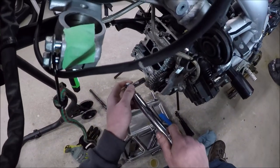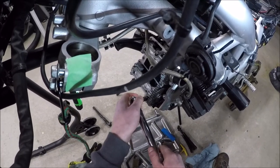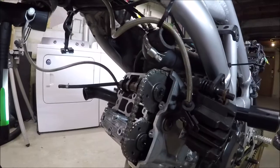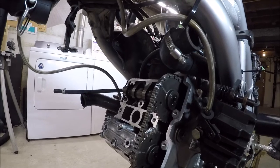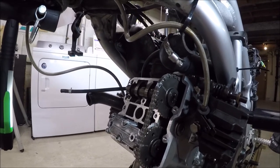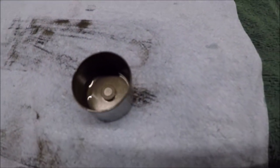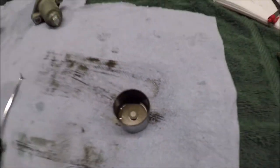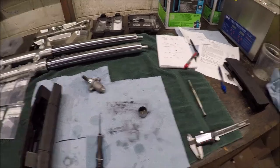I'm going to do the same thing on the intake. I don't think I'm going to bother showing it because it's going to be the exact same as the exhaust here. But if there's anything worth showing, I'll show you. If not, then just assume it went swimmingly. I guess this is noteworthy. So I'm just looking at one of the intakes and that's a 1.8 inside of there on that first one. So I thought I'd see everything between 1.65 and 1.75. So that's a 1.8.